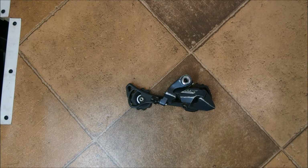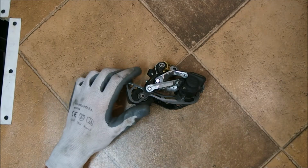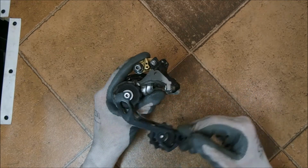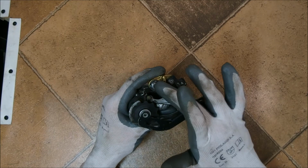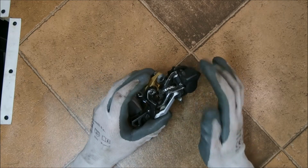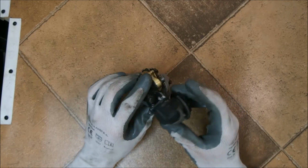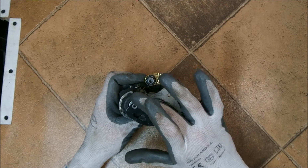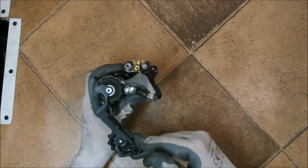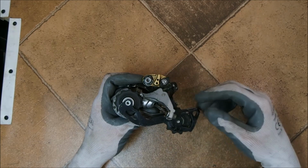The other derailleur design type is what I call a single pivot design, and this Saint / Dyna-Sys is an example of one. As the name suggests, there is only a single pivot here for the cage to rotate around, and the connection to the frame is fully rigid. This has major advantages for mountain riders. First of all, since the connection to the frame is rigid, it simply can't clank on the frame, so it's much more silent. Moreover, because this guide pulley moves very little or not at all as the chain is taken out, there is much more chain security for the entire drivetrain.